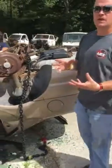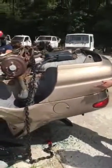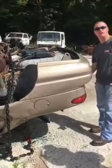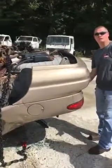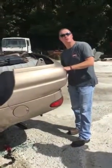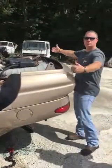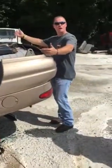That brings something else to the table, because if you're going to do it with airbags, we're going to shove 2 airbags underneath the C-post or D-post of this car, but then what do you have to build up back here? Big crib tower? And we ain't got that much. Most people, especially a city department, probably don't have enough cribbing to do that. So let's just say that we're going to do that lift. Well, guess what your struts can do? They can be your secondary means of stabilization to an airbag lift.